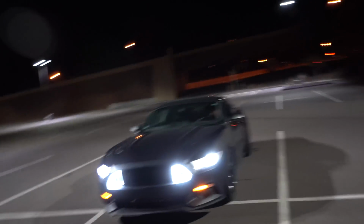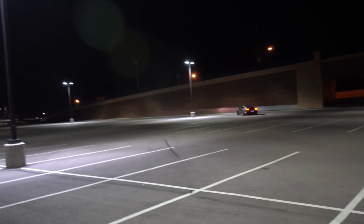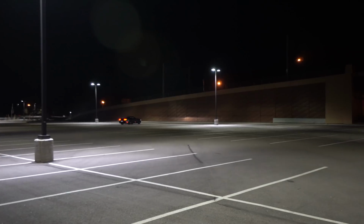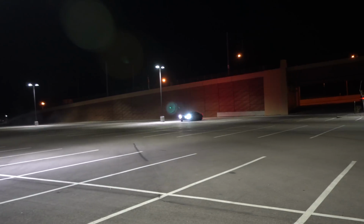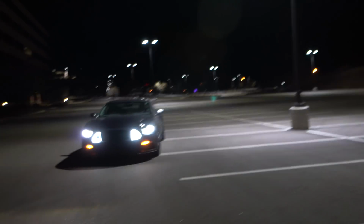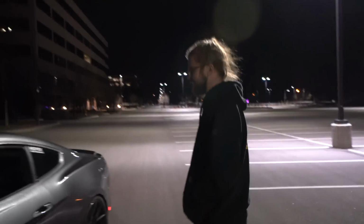So in order to make sure we're gonna get home, we gotta give this the test, right? Give the test. Gotta get that boost line and that vacuum leak fixed. Yeah, needs more boost. I tried second gear, I went faster, but it's kind of sketchy with the manual brakes. Yeah, never drive it anymore. Fix the vacuum leak.